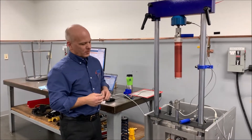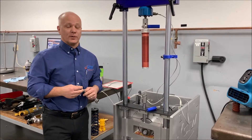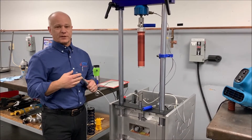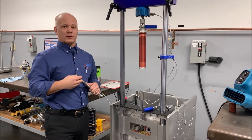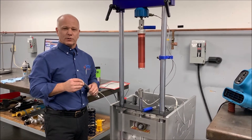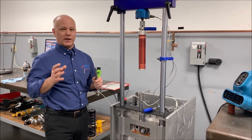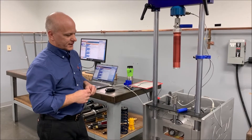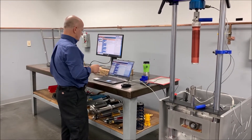You can see it runs that two-second warmup and then it goes and does the gas test, and it's going to settle for three and a half seconds. Something to know as background: we allow the inverters to stop for up to four seconds. So if you set your settle time up to four seconds, you will basically stop at that point. If you set it for more, eventually the inverter releases and you may get a bad gas test force reading. All of the dynos and all the CTWs right now are set on four. So I did the gas test — that's primarily where I'm going to get the data from — and it's running the slow speed tests. I'm going to save the data and we'll show you the next step.